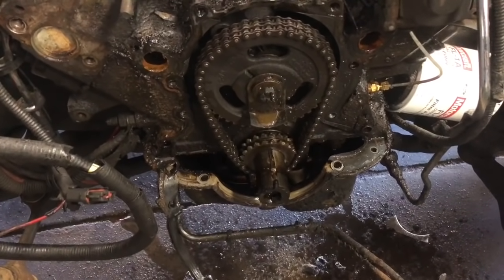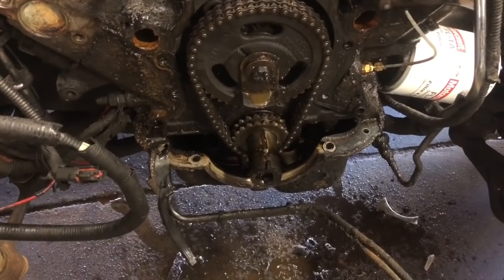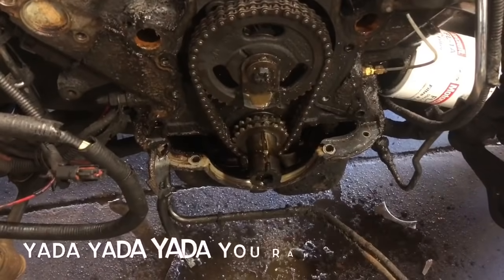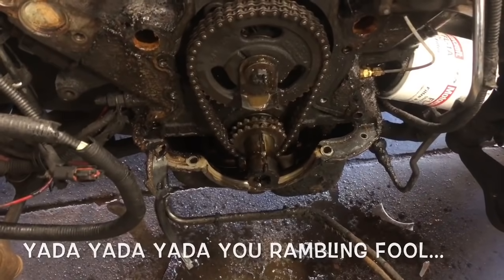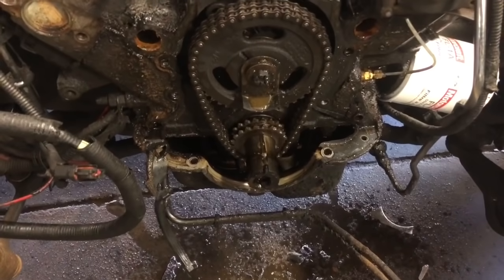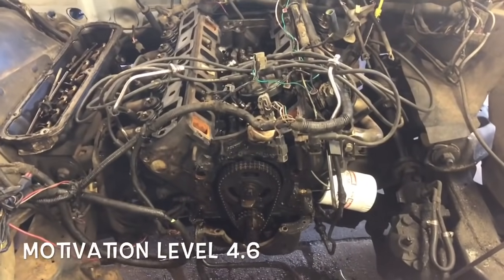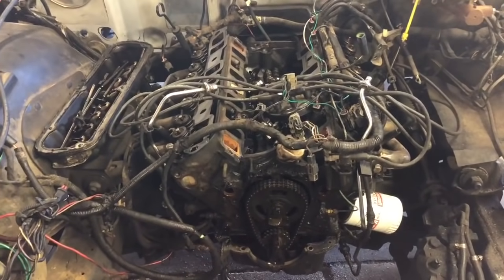We'll come in tomorrow and obviously pull the timing chain off and pull the old cam out and lube up our HO cam, stick it in, put our new timing chain on, and put a new seal in the timing cover and kind of put it all back together again. And then see what we got. We also got to change out the computer and a few other things. So anyway, we did get something done. It's basically been 3 weeks, but we did get some car work done.